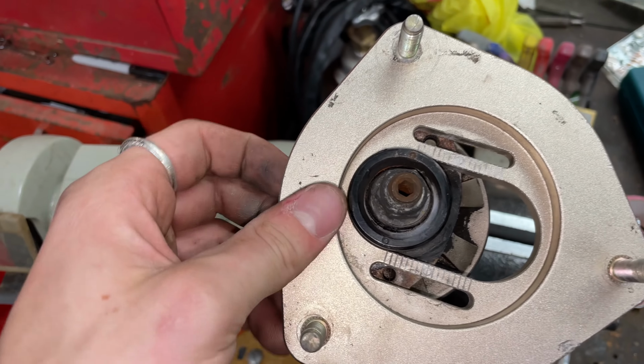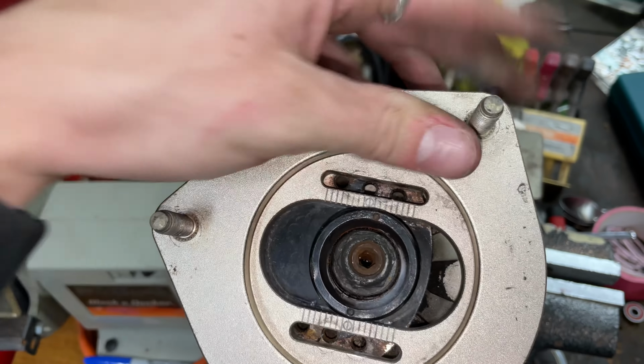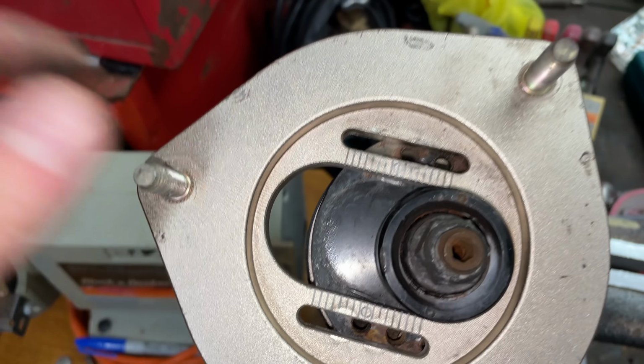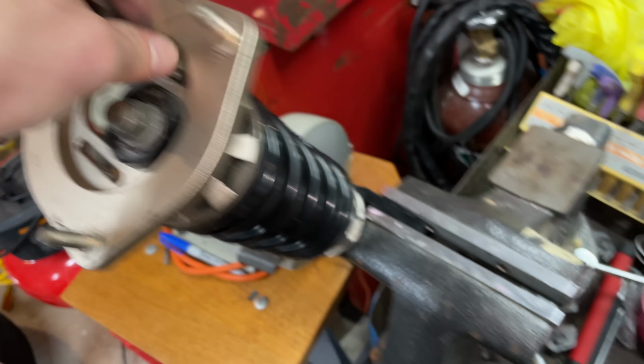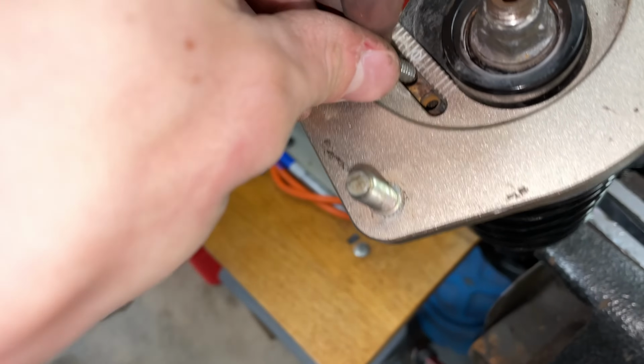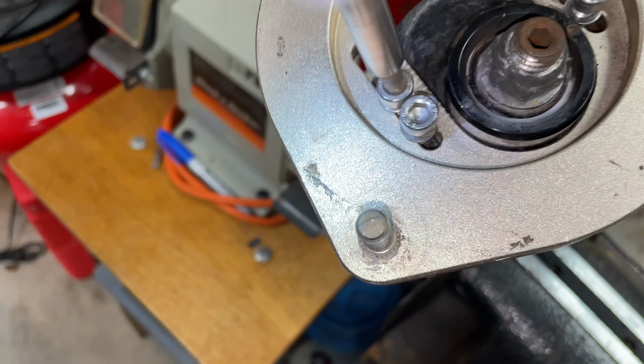Now, the reason I took the bolts out is because when you max out the camber, you only have one hole there. So what you want to do is spin this around, spin it all the way like this, and now you got two bolt holes, and you'll be safe again. I've seen one too many kids flexing their camber on the gram with only one of these bolts in the top on each side. It's quite cringe.